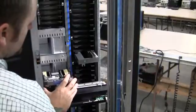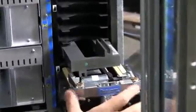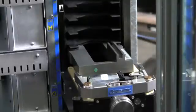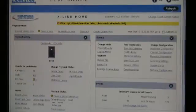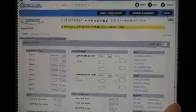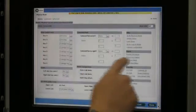We want to make sure that the alignment tool is placed in there snug. Push down the X-beam, align the gripper, and make sure that the guide rod aligns with the gripper channel. We want to make sure it's flush — that the alignment tool is sitting flush inside the hub of the gripper. Once the alignment tool and gripper are in place, we need to go back into the service view and go to hardware configuration, where we have the alignment options for the library.